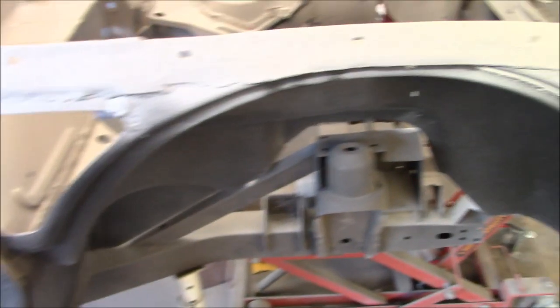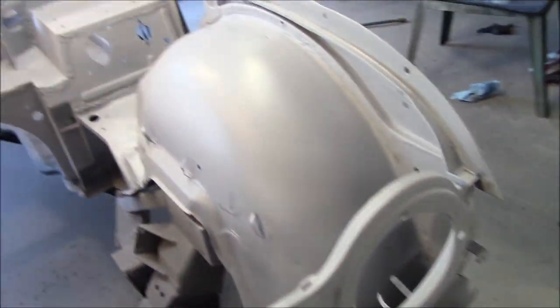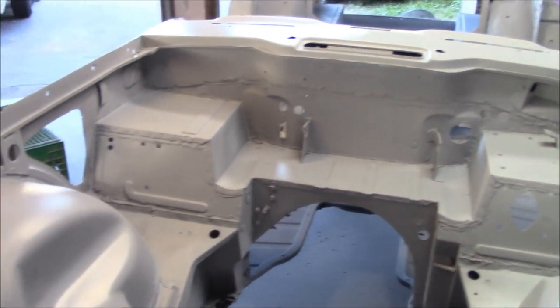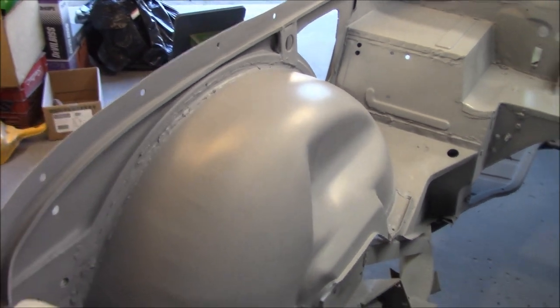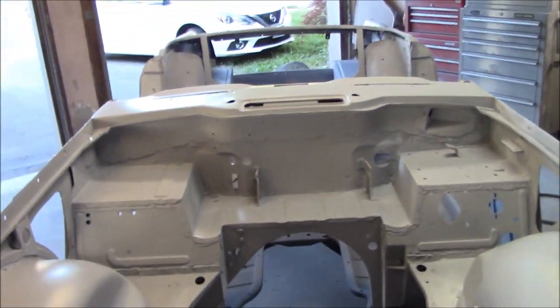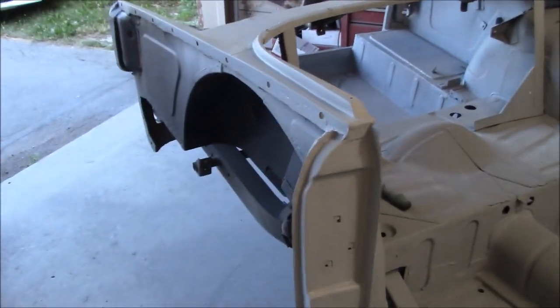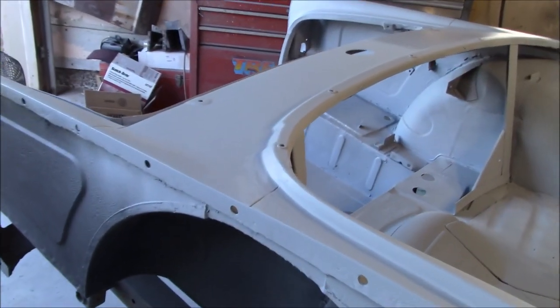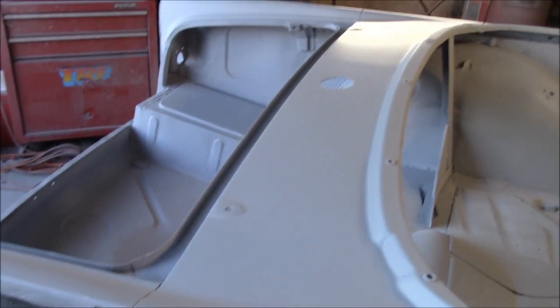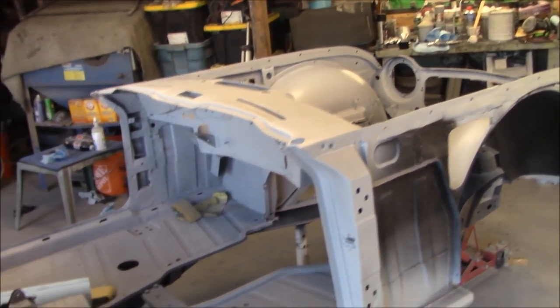Other than that it looks pretty good. The only thing remaining is the front, so I might wait for it to cool down and come back out around 9 o'clock to do a little sanding on that front so we can get it ready for its final coat of primer tomorrow. Then we'll start at the back of the car sanding with 400 grit - since it's all blocked I think I can start with 400 and finish with 600 wet.